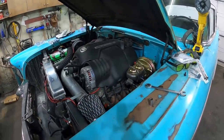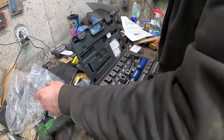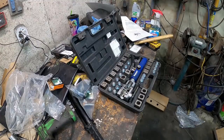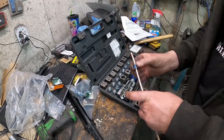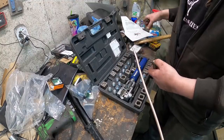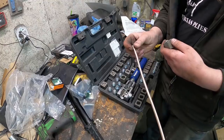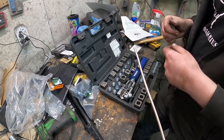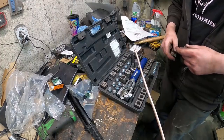So I've got this new stuff strung out a little bit to show you how to do some flaring. I got the flaring kit out — it's actually my buddy Mike's kit that I borrowed, and honestly I think I've used it more than he has because I just kind of refuse to give it back. It's so handy but so expensive — I probably should invest in one. So this is the line on the roll, I already have the fitting on — lesson learned. It's got this fancy little flaring tool: you crimp it, push your thing through a couple little bits, and you get a perfect flare every time. This stuff is so soft you could do it with a regular flaring tool, but I love this thing. My plan is to get this end flared, snake it up, go snug into the metering block, and then go straight back — and I'll flare the other side under the car, which is going to be a pain.